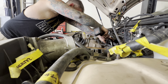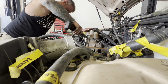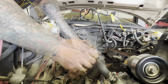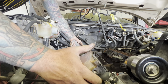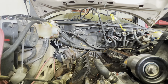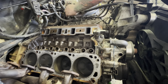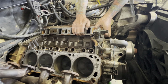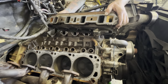I think there is a bent pushrod. Andrea's other Fairlane, a ZL Fairlane, a little while back had a bent pushrod and ran like absolute junk. I literally needed to replace two bent pushrods and from then on it was perfect. So I'm hoping this is a similar scenario — that's the weakest link in the engine. Once you've got a load of water in, something's going to give, and I'm hoping it's a pushrod. So I'm going to start marking off everything under this engine bay so I don't lose track of what's what. We'll start pulling some things down, get these rocker covers off, and see what we've got to play with.